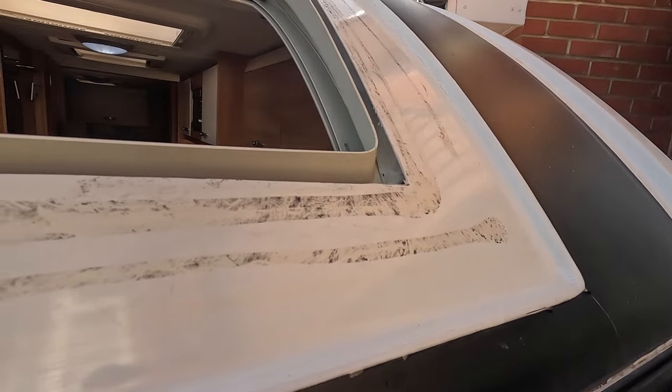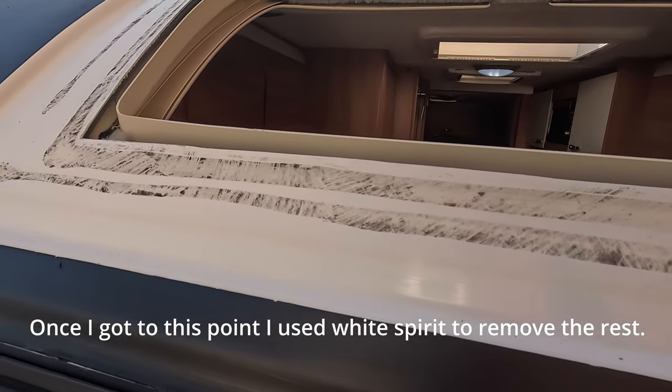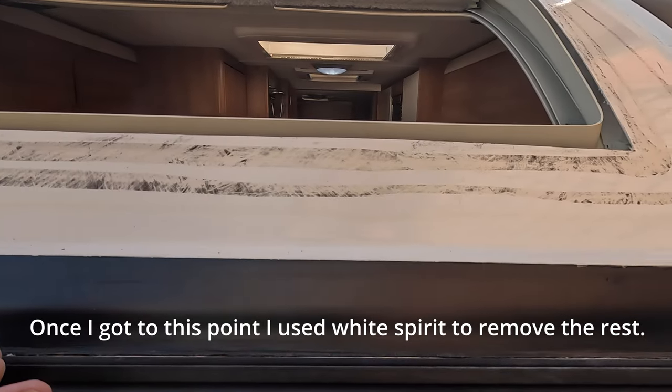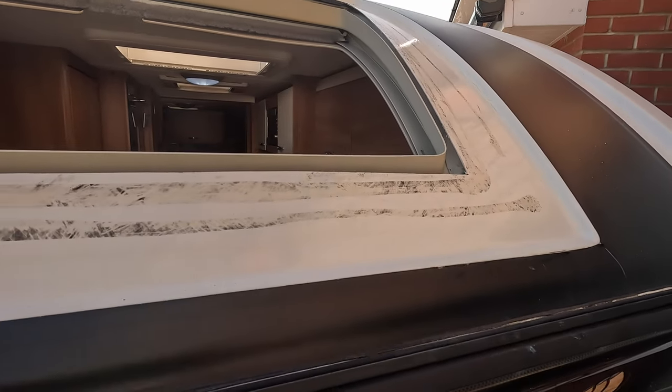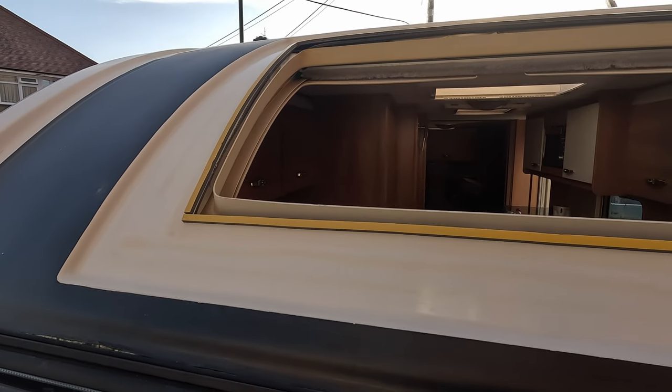Right, so that is the chemical that I've used on it, and it does take off the majority. So now it'll be a case of getting some of the other chemical to get the last bit off and then buff it back up before applying the window. Rightio, so that is it all cleaned up, wiped down, put the foam around the edge of the window. The other foam would go on the window itself. I'll then marry it up, get it all ready for the sealant.